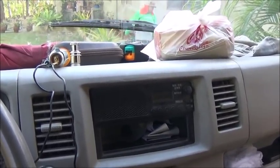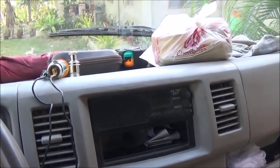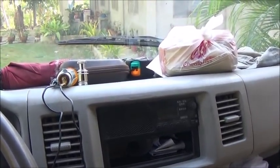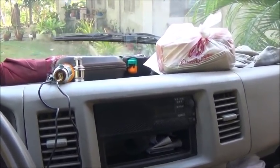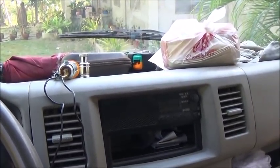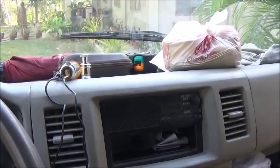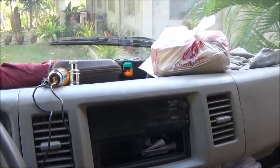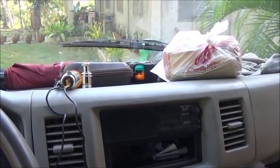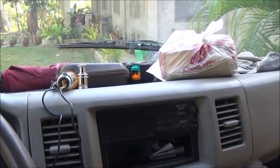So it's not a long enough, large power draw to get your wires hot. In like 5 minutes it would seriously challenge the size of these wires, but just for 10 or 20 seconds, no problem at all. And this is rarely, if ever, going to be used as a cigarette lighter per se — it's only going to be used as a charger. And you're only talking 1 amp, maybe, using it as a charger. So there's no danger in the size of the wire.